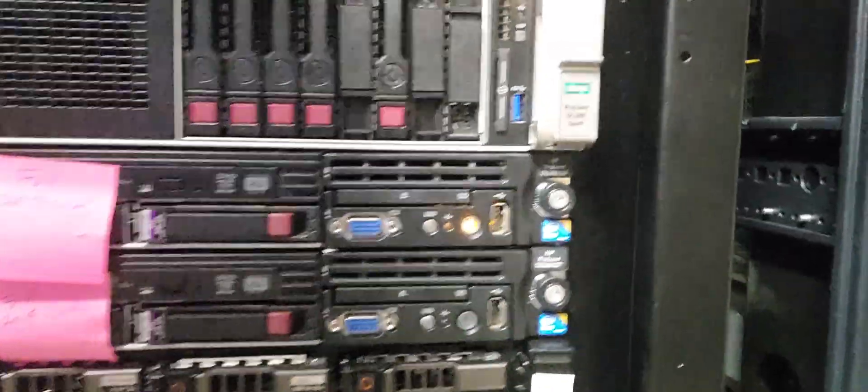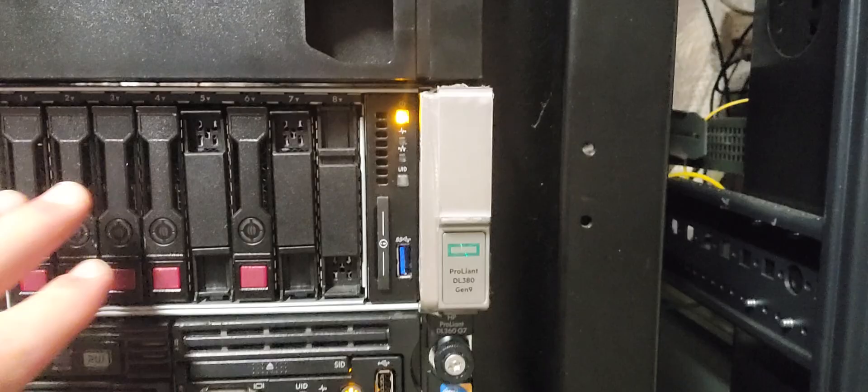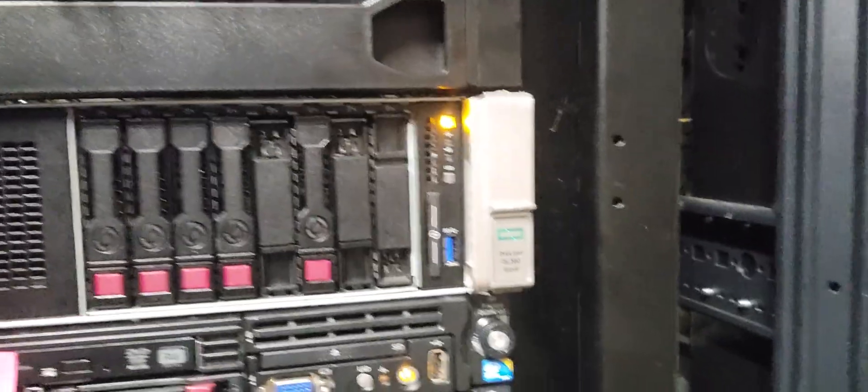In other words, if you've seen my videos, I said go out and get yourself a four-bay or an eight-bay. What happens is you use something like this to connect to the SATA bridging connections on the back end of the SAS bus card. This guy right here is a drive bay, and it has two bridge connection SAS connectors on the back — or you can get a version that has four, or in this case eight, SATA connection interfaces. You can use SATA as part of SAS, but that's the only way.